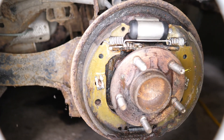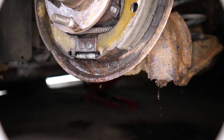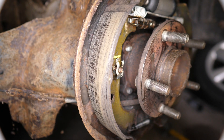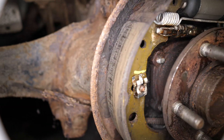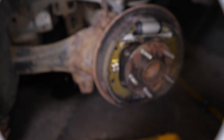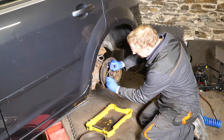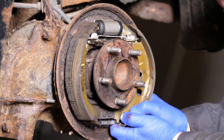As you can see, it pushes against the outer edge of the hub so you don't cause any damage. We can see the self-adjuster there. There is a bit of brake pad material on there — admittedly not a lot, but they haven't fallen off like they had on my trailer. This cable is about to snap by the look of it, it's fraying, so I'll have to order a couple of those. We'll start taking it all apart, clean everything up, put some grease on there, and hopefully get things to work a bit more smoothly.